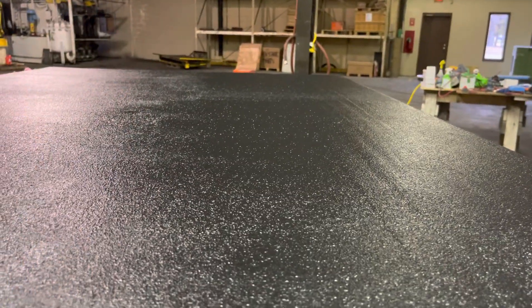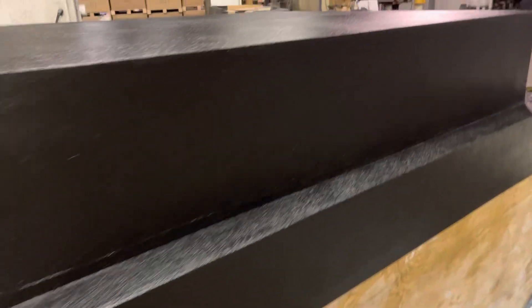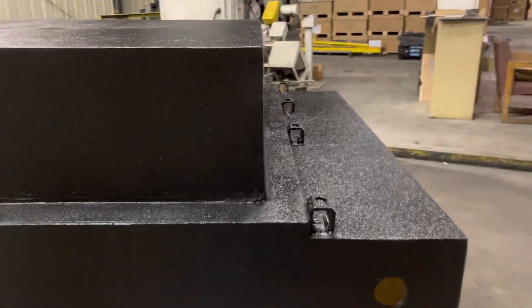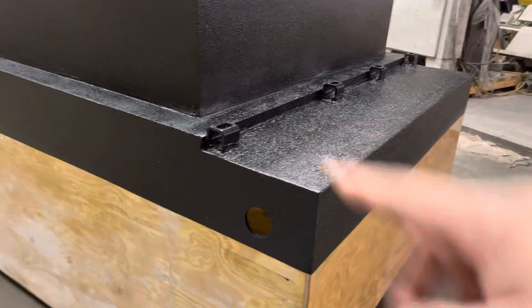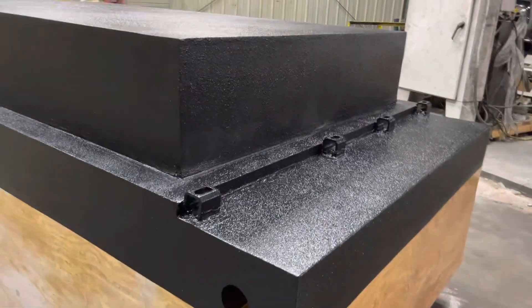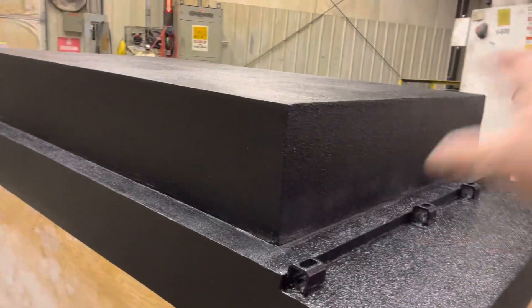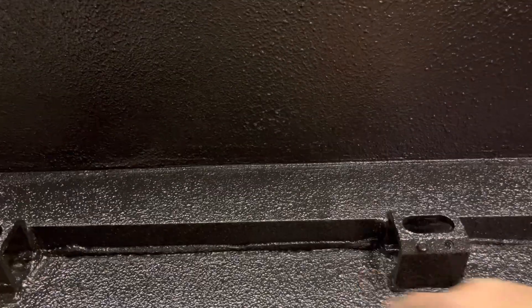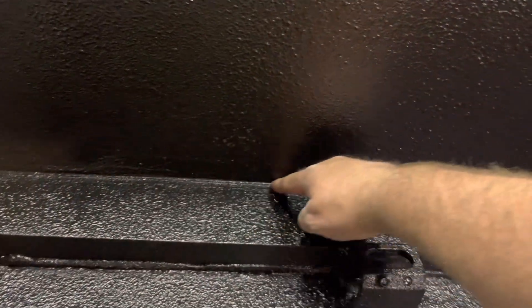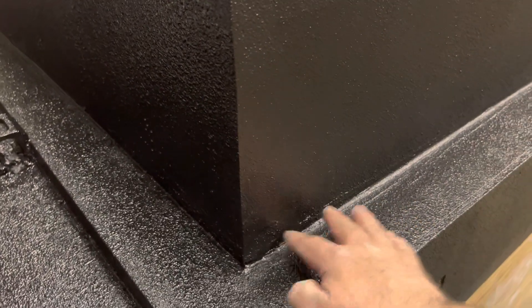I figured I'd put this out there and let you guys know how well it's going and how impressed I am with this product. I'll suggest it to anybody looking for something tough. This trailer is now 100% waterproof up to that line — 100% waterproof, with the exception of the door openings. Between fiber glassing all of this, epoxy fiber glassing it, putting an extra coat of epoxy, and then two coats of Raptor liner on top — this is completely impervious to water. Every inch in here is covered with Raptor liner and butyl tape.